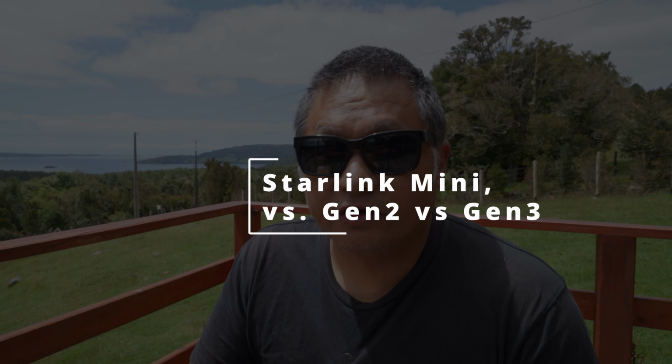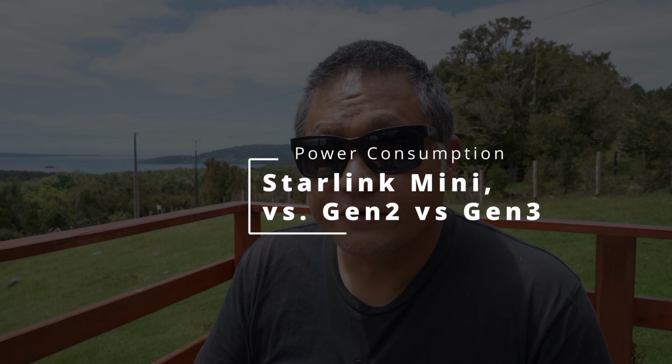The biggest difference here is in the power consumption. And the main reason why I switched to the Starlink Mini is because of the power consumption as well. In my time using the Starlink Mini dish, I have measured that it uses almost exactly half the amount of power that the Gen 2 dish uses. It averages about 24 watts over a 24-hour period, meaning it uses about 570 watt hours, versus my Gen 2 dish, which used to use over a kilowatt hour over that same time frame.